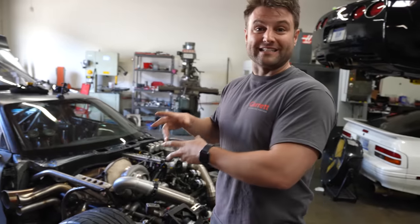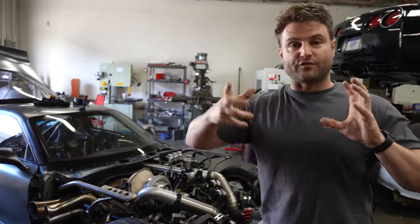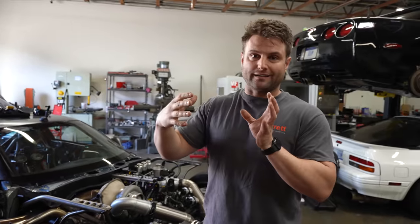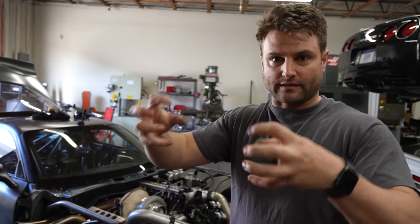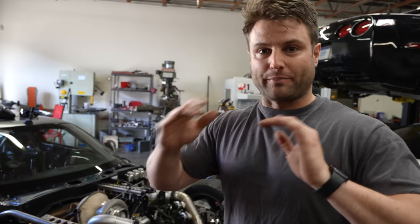But what I'm expecting to see is each tire moving slightly different speeds, maybe a little bit while turning, and we'll take a look at that. And then also braking. Hey, do the fronts stop before the rears? You kind of actually want the fronts to lock up before the rears, just slightly. But you balance that out, I think we can do all of this sort of data and make the car really capable of sticking to the ground with having four wheel speed sensors from an ABS system.